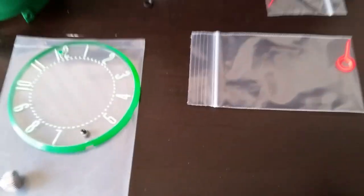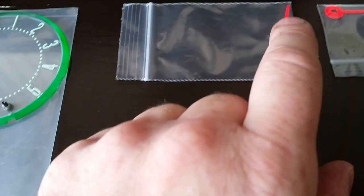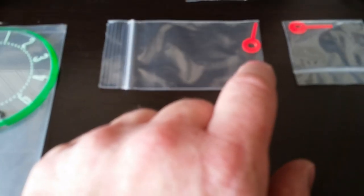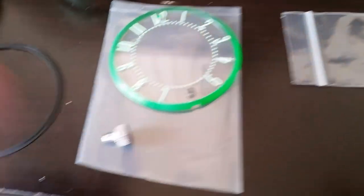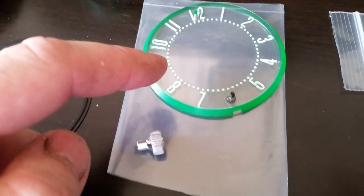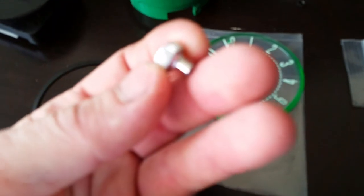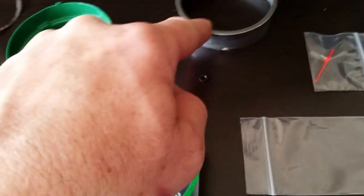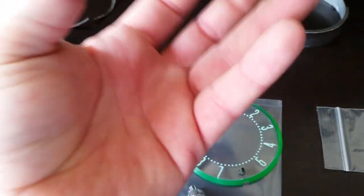I get the clock movement and usually all the hands are gold. I've restored all of my gauge assembly and speedometer assembly and I use this orange paint on the needles — it actually matches the three AutoMeter gauges going in the A-pillar gauge pod. So the needle colors match, and it's also a black background. I got a new reproduction clock lens, this is an original knob I just cleaned and polished, and then the clock bezel.